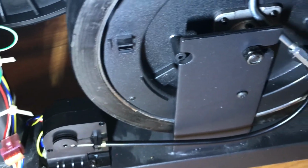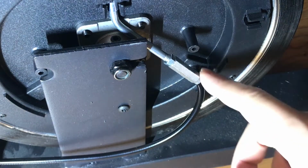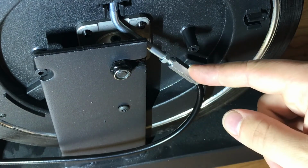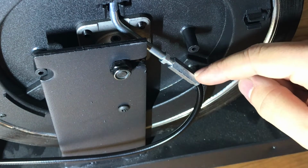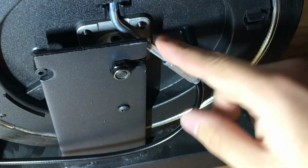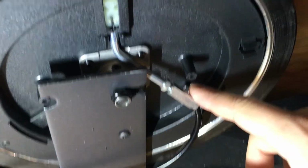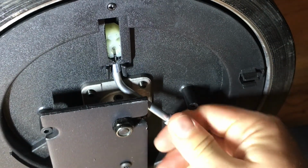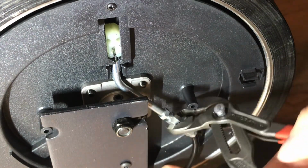Last thing I'll mention, if you are noticing that the resistance is still a little bit too much, even on the lowest setting, what you can do is adjust this. So what you would do is you would loosen this so that this barrel comes down, and then you just tighten this jam nut so it doesn't move. So basically, I'll try and say that a different way. So essentially, as you move this, I can even show you, watch. Watch that little cable. I don't have the right size pliers, so we'll do this.